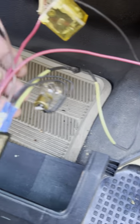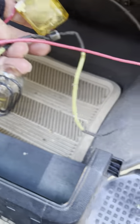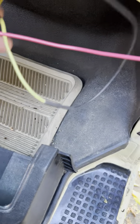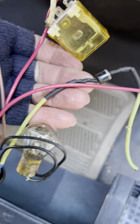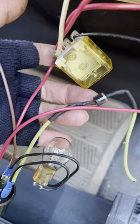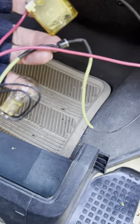The power comes out to trigger the relay from the flasher here. And I found that by adding a rectifier diode between the flasher and the relay, it seemed to help the relay not do a funky click and instead do a nice solid back and forth.